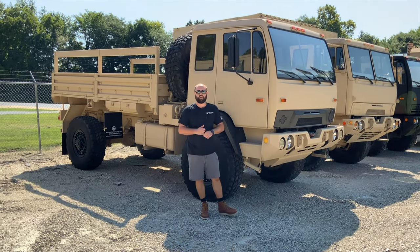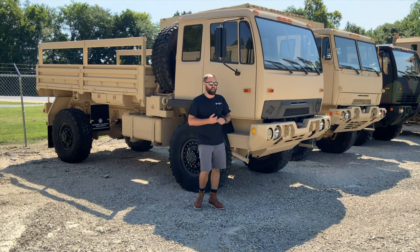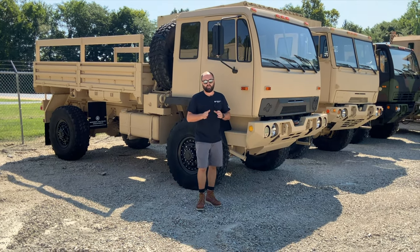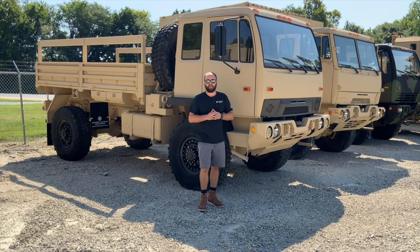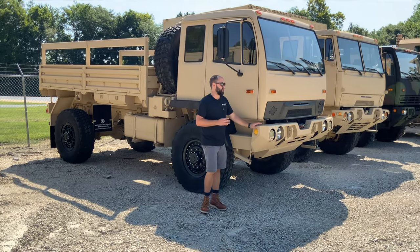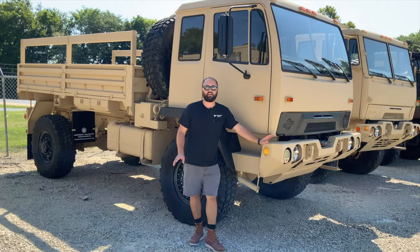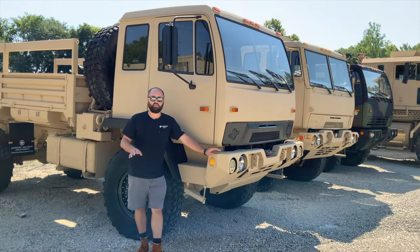After that, from 1999 to early 2004, some 2004 trucks were A1Rs and some were not — it was a carryover year with some differences. The A0 trucks have a 3116 CAT turbocharged engine. It's a fully mechanical engine — there are no electronics, no ECM, nothing of that nature.